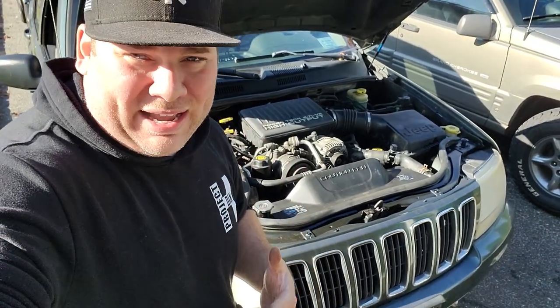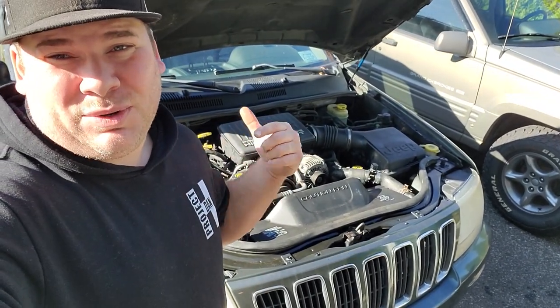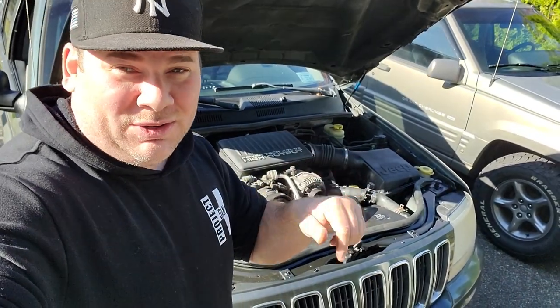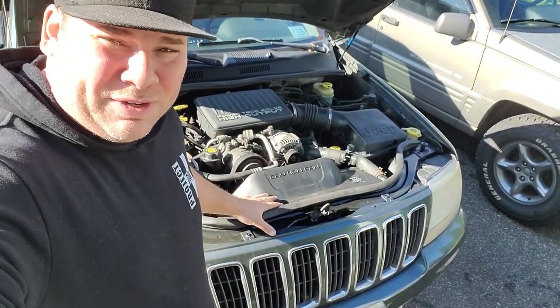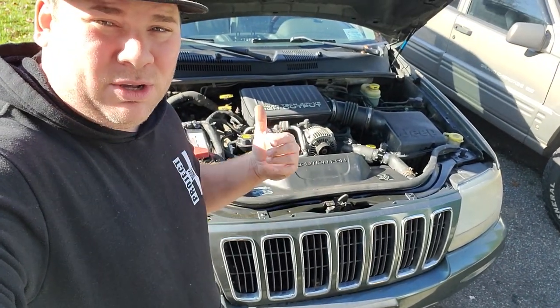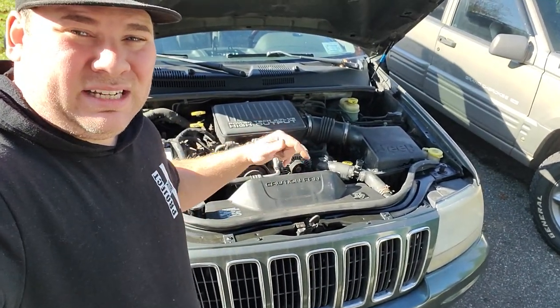So I went and got another fan — this is the fan I have in now. Then I went to the dealership and got power steering fluid, but they gave me the wrong fluid. The hydro fan in the WJ needs Mopar power steering fluid, part number MS10838. But I'm still throwing codes even with the right fan, the right solenoid, and the right fluid — still got that 1499 code. Could be the wiring: if it's not the fan and not the solenoid, it's probably the wiring. This wire harness coming out of the hydraulic fan solenoid doesn't have the ribbed sheath. The previous owner apparently chased a broken wire up to a zip tie near the battery tray and gave up. I'm going to deal with that later and jump into the O2 sensor code first.